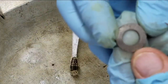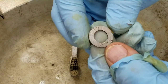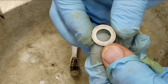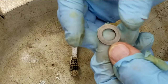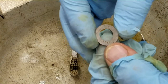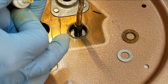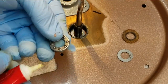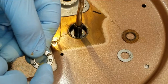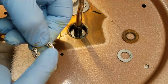The same deal with this guy. This side has a bit of corrosion on it — it's machined just like the other side but it's a little corroded. The balls haven't been riding on it, but if you look carefully you can see the witness mark of the balls on the other side — nice and clean. That's the side you want facing the balls. You don't want to put the corroded side against the balls because that pitting will damage them.